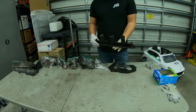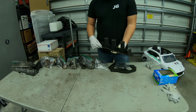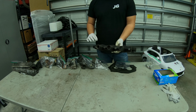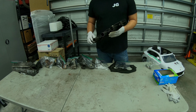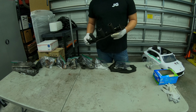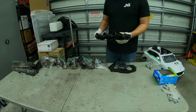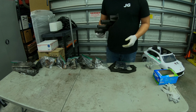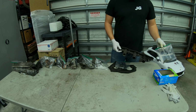And there's a gasket that goes around the top. And this one's totally smoked. It's flat and dry and brittle. And the new one that comes is all soft. So just a little thing to touch on that. This is one thing you should know if you're going to work on these cars. There's extra gaskets and stuff underneath the intake manifold that you might not be expecting, that need maintenance, and I feel like are overlooked all the time.